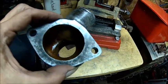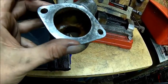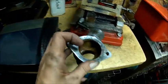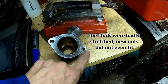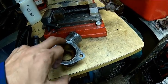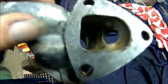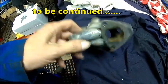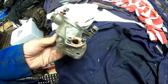Here we got the coolant filler housing — it's extremely pitted. I checked it over the surface plate and it's not flat anymore, as someone pulled it down — probably too much force — because it's threading here and here and a little bit here, and that's why it's leaking. Here we got the same problem: all the gasket surfaces are really badly pitted and dirty. It was full of limescale, so we give that a clean and make it pretty again. Hopefully it's okay.